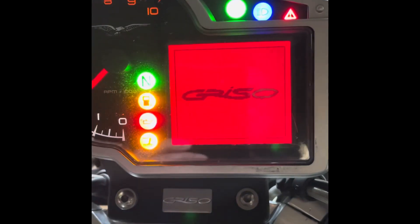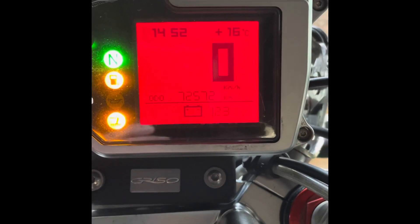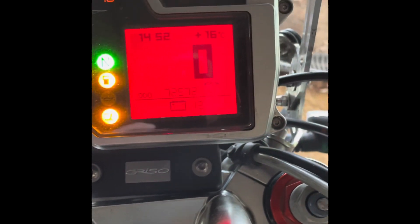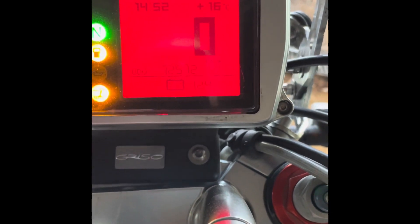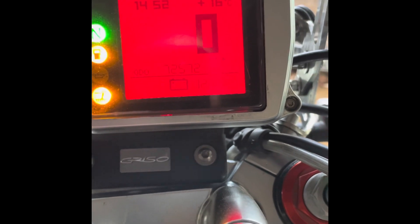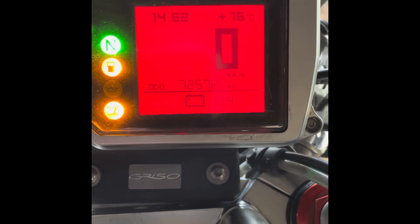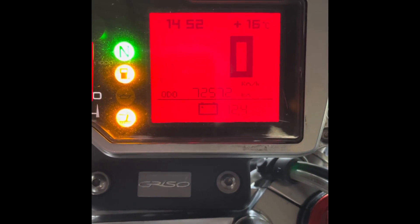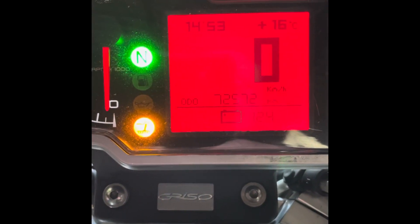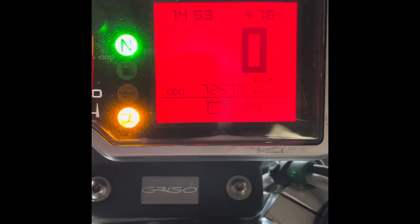If you haven't got a user code you're going to be stuck waiting for a tow truck at considerable expense. It is worth putting in a code. When you first get a new dash you will find that the original default code is five zeros, and you can always put that code back in — you will then get the 'don't forget to insert your user code' message again at key-on. But if you have a separate user code that you've installed yourself, it's an extra level of security — if anybody tries to steal the bike it's going to ask for the user code and they won't know it. In the next video we will go into what happens if you've bought a bike and you don't know the user code for it.